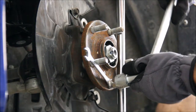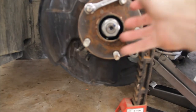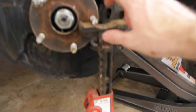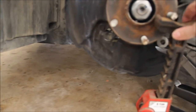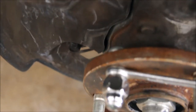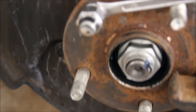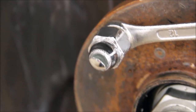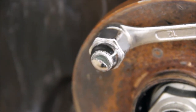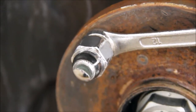I got it in. The system I figured out was that every time you tried to tighten the new stud, the hub bore would just rotate with it. What I figured out was if you put a jack stand to hold one of the studs, you could literally tighten it so easy and the jack stand will just keep it from rotating. There is literally no gap and I got the new stud in perfectly. I used the wrench as my washers — one 12mm wrench, circle side — and I tightened it so much that the back of the lug nut is coming off because the stud is pushing through it.